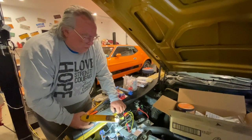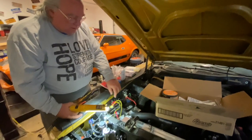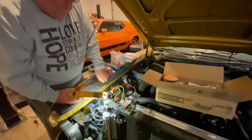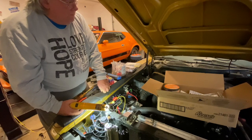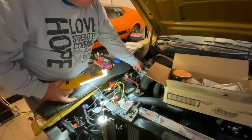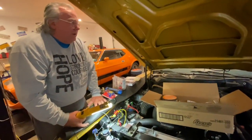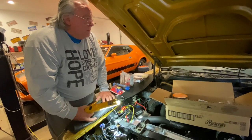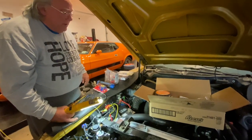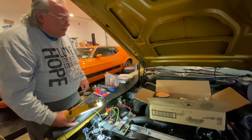What makes that bad news is that where I need to run the wire for the LED lights is along the same route that I'm running the wire for the trigger voltage — which is switched electrical voltage. So I need to go along all this conduit and wherever I have conduit, I need to open it up and put the new wire in there that's going to be used to feed the LED light. That doesn't sound like a big deal, but that's because I'm the one who's been bending over doing it — cutting what I had wrapped up so nicely before.